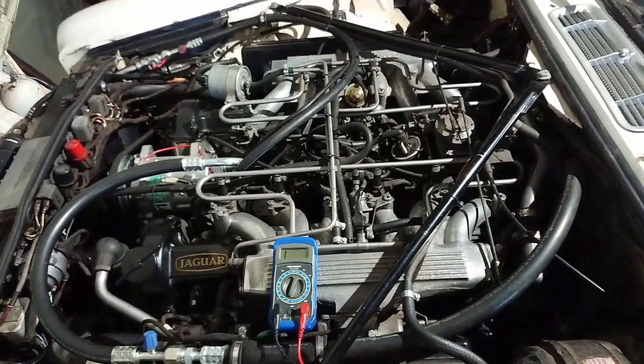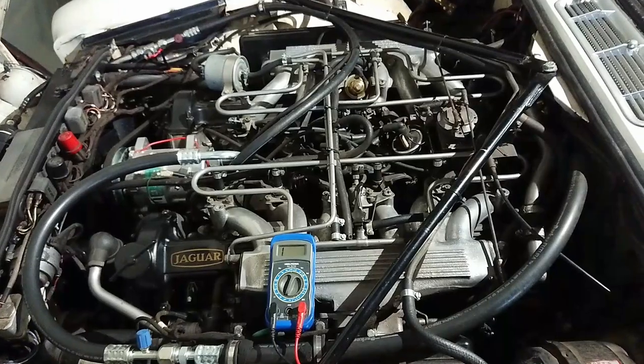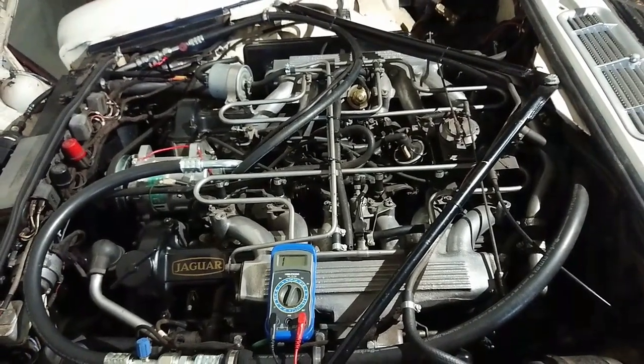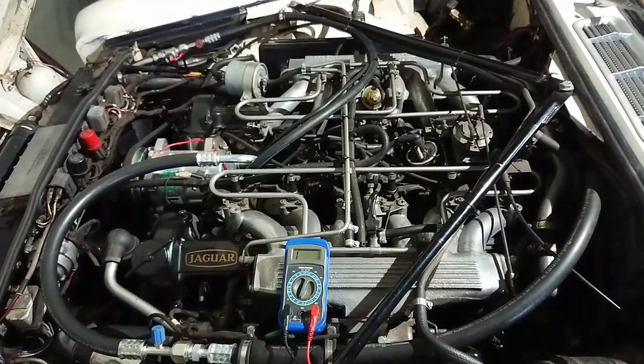And that's all of it — that's how you go through and check the connections on this fuel injection system. As you can see, there's not that much to check. It's really not that complicated; you can easily do it in an hour and go through and clean the whole system. If connections on your car are broken — let's say the sensor is fine but the cable is frayed — you can still get these connectors, they're standard Bosch items used on many different cars, so there's no problem getting connections or making a new harness for yourself.